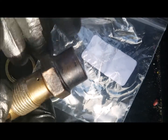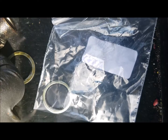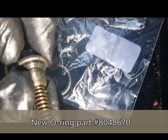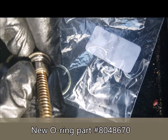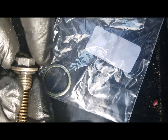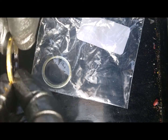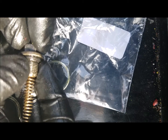I have the new gasket. I cleaned up the tensioner a bit so I can spot any new drips. There's also a gasket on the screw — a little rubber gasket that you may want to order as well. On this one there's a little break in the rubber, so this was more likely the actual culprit of my oil leak rather than the main tensioner gasket itself, which still looks pretty well intact. Piece of advice: if you're going to do this job, order this gasket as well as the little rubber grommet for the screw.